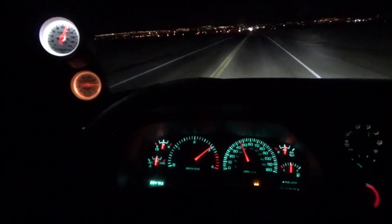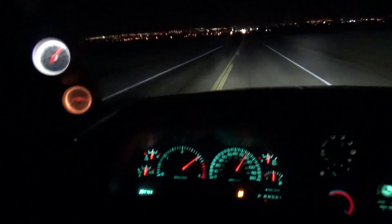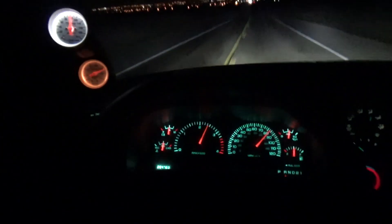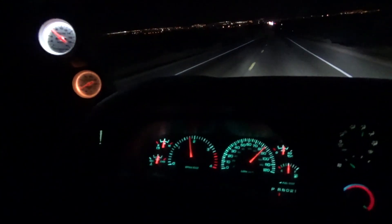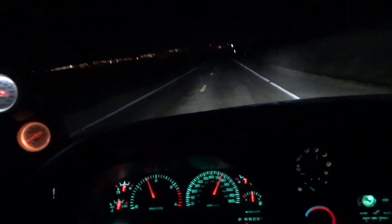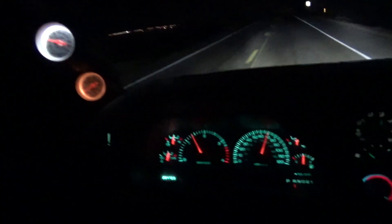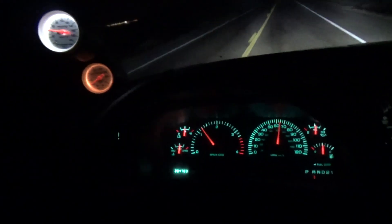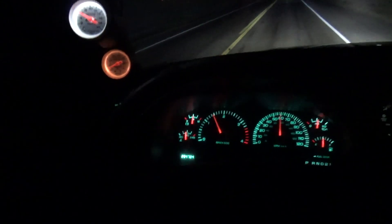30 pounds of boost, 1100 EGT. 30... 12... 33 pounds of boost. It feels pretty good, smooth, and accelerates pretty good. The EGTs went down a little bit — normally they'd go up to like 14 or 15 hundred and I'd have to let out, but this new billet wheel and the ported housing, I know they said the billet wheel loses boost, but I didn't see any loss of boost. I have that J-hook on to give me a little more boost — about 10 to 12 pounds. Looks like it peaks at 33 pounds.